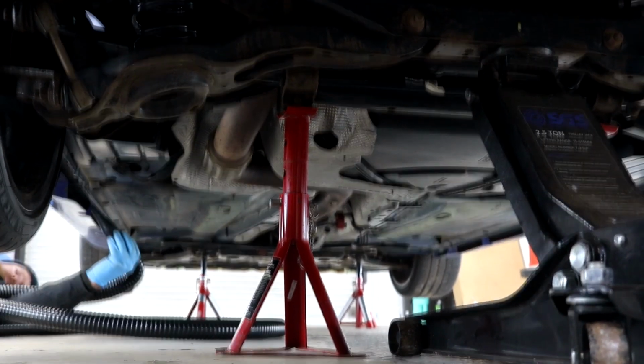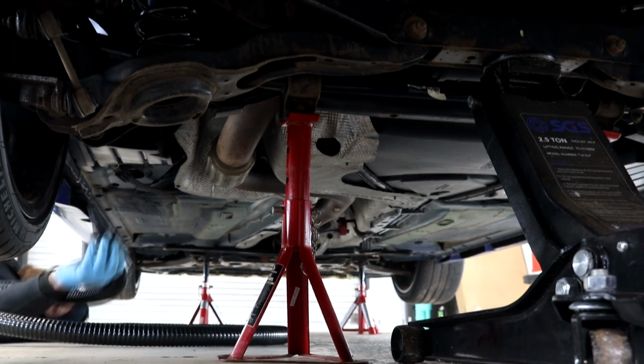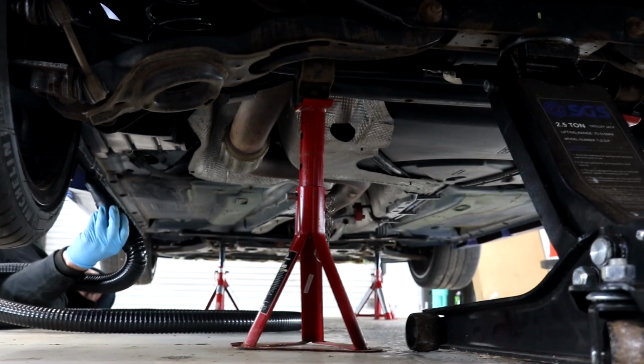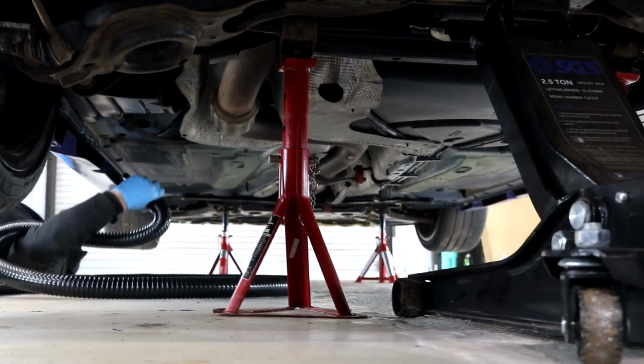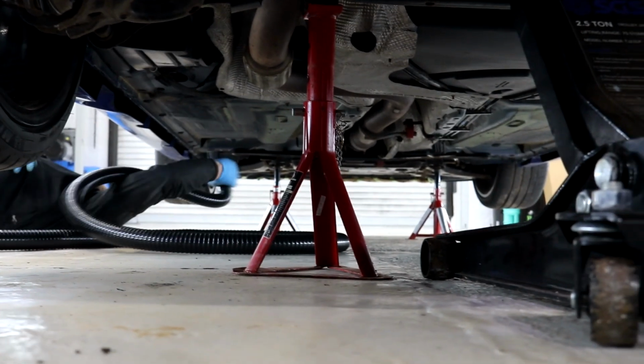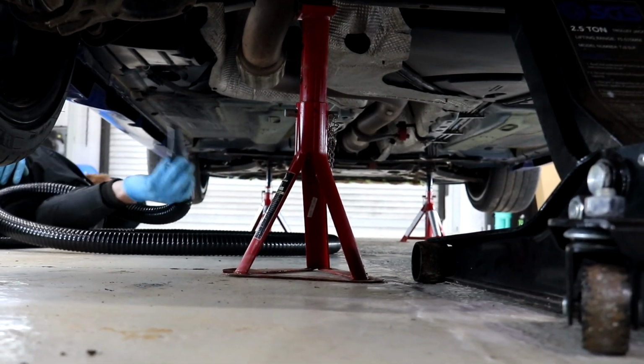After the wire brush stage was finished to a satisfactory standard, we blew out the gaps and crevices incredibly thoroughly. Not only did this remove the dried out rust dust, but it also allowed me to get under the car and fling out further grains of gravel from the inside of the side skirts.